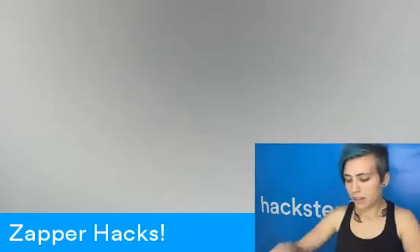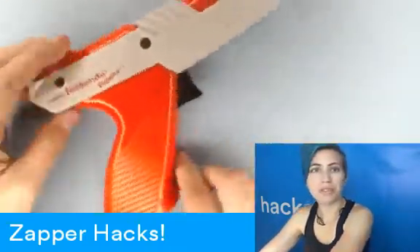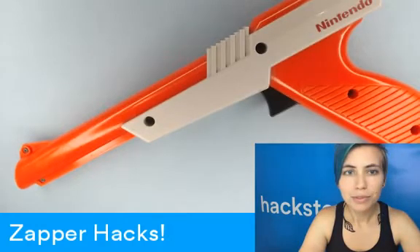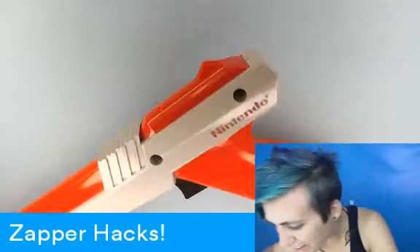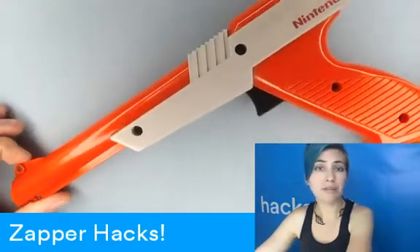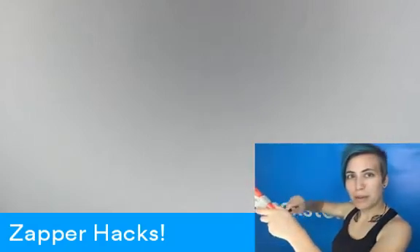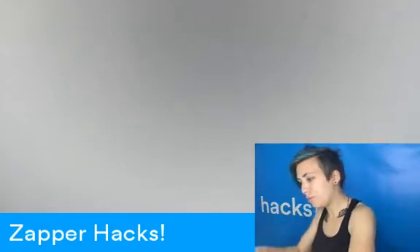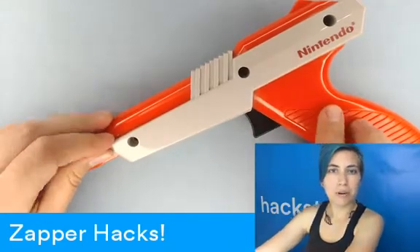The zapper itself is gorgeous, of course. It's assembled with screws that are really easy to remove, so let's go ahead and do that. Pretty standard Phillips heads in here, given the age. Flatheads on the small ones. Also, given the age of the gun and what it might have been through, some screws might be stripped — just use an appropriate amount of force and you'll be able to get it apart. Take the grey plastic part off first, and then the orange part will be much easier to dismantle.